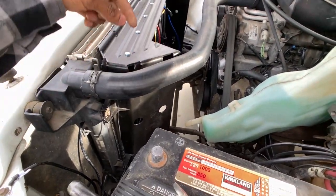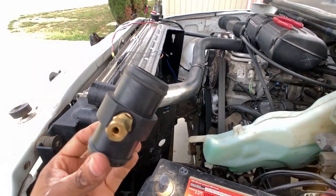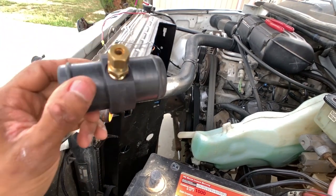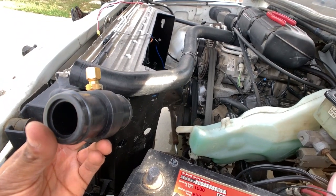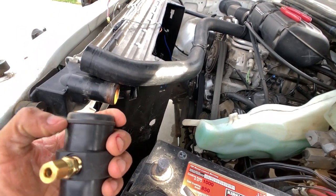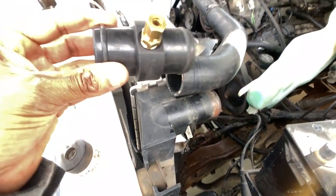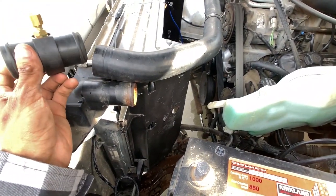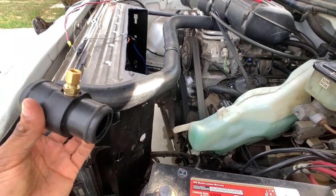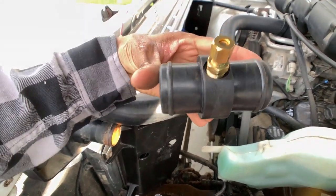I need to take some coolant out so I can put my adapter in — this is where my sending unit is going to be. In case you're wondering, the adapter I'm using is 36mm to 40 or 44mm — I believe it's a 1.5 inch inner diameter. It has a double sleeve, and I had to put this sleeve on for it to fit. It'll be a really snug, tight fit, which is exactly how you want it. Don't install it without the sleeve — it can just pop off with the heat and you don't want radiator fluid flying all over your engine bay.